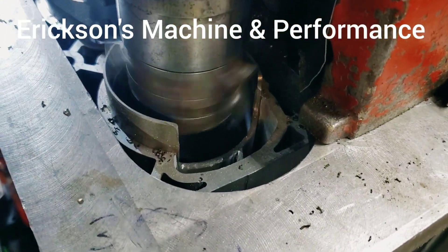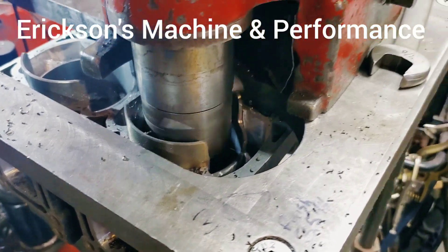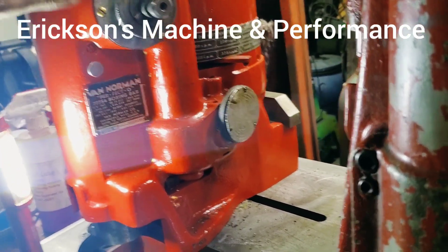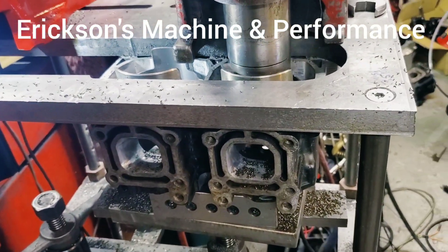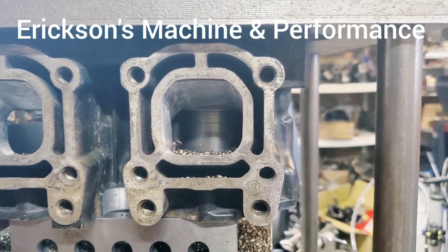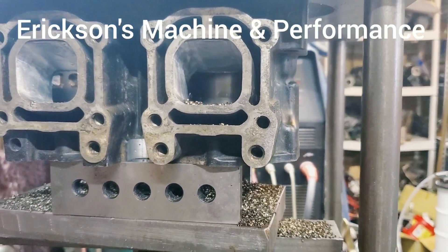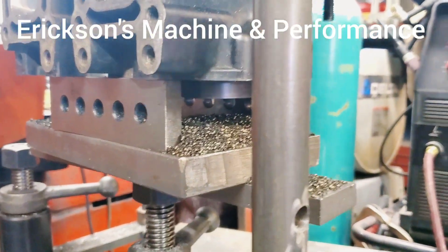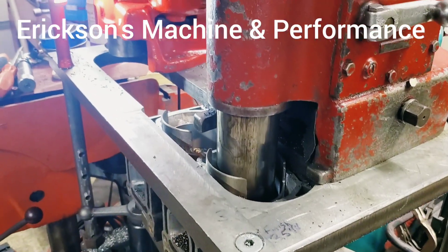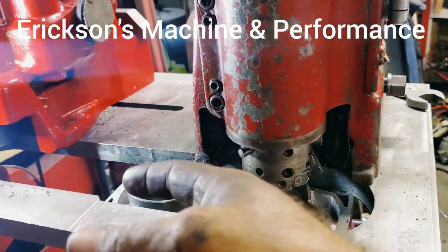That's how a cylinder gets bored. It will go all the way down, and when it gets to the bottom I will reverse it all the way up. This bar is nice — it actually has a power feed back up. My other bar, which is a Van Norman instead of a Quick Way, is also a phenomenal bar, but you have to hand crank it up. You can hear the interrupted cut going through the exhaust port as it drops down. Now the cutter is no longer cutting, so we reverse the bar, bring the cutting head out of the hole, shut the bar off, and get ready to move to the next hole.